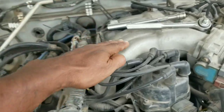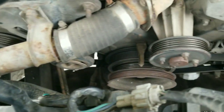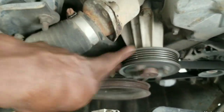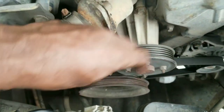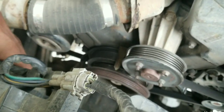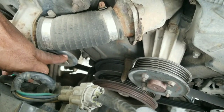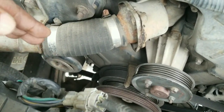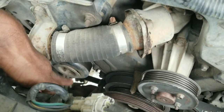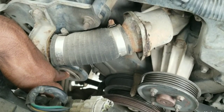The engine is cool to the touch and the belt for the water pump, power steering, and harmonic balancer has been removed. When we run our hands on the pump we can see we have a nice smooth running bearing, which means that's good. Same thing for the idler — we run our fingers on the idler and it's nice and smooth. This idler pulley bearing was changed approximately 30,000 miles ago. In the video description you will see a link on how to service the bearing inside of this steel pulley — it's not plastic, that is why you want to service it.